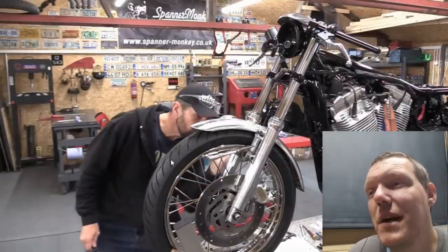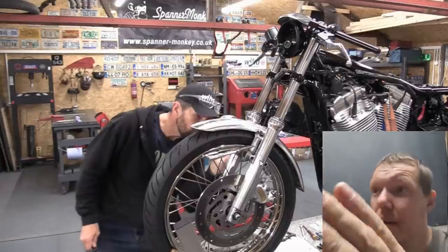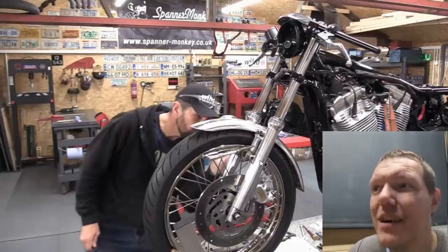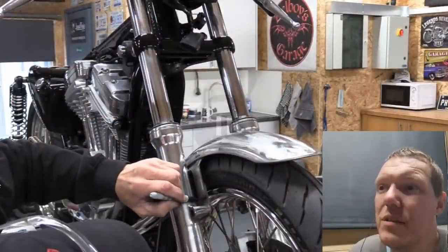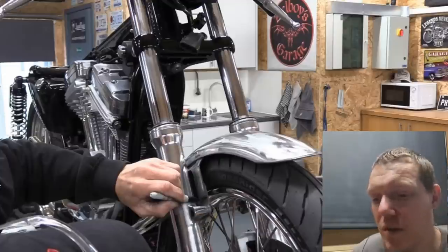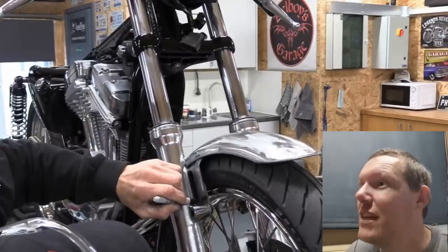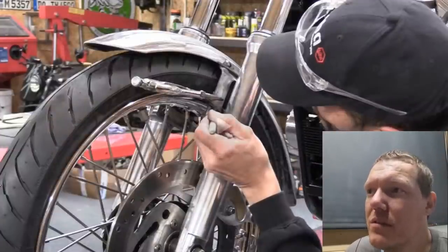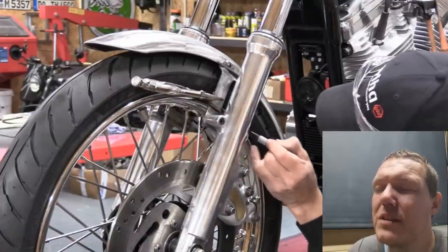Now this is a bad thing. If you've cut it and de-shaved it, really what you should do is just cut that, then put it back together through measurement - putting it on, clipping it on, then drawing lines. Using only measurement to define where you are is not the best way to do it, because you can't tell if that's crooked or not. Then you take it off, weld it, and you go - oh that leg's five millimetres longer than the other one. It all depends on how accurate your cut is. You shouldn't grind the edges because you're going to lose your original cut line.